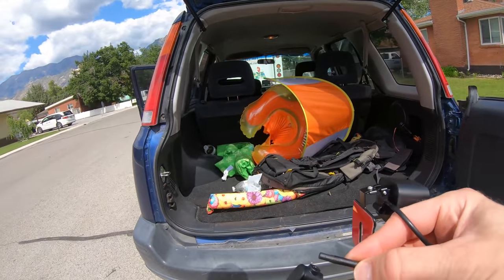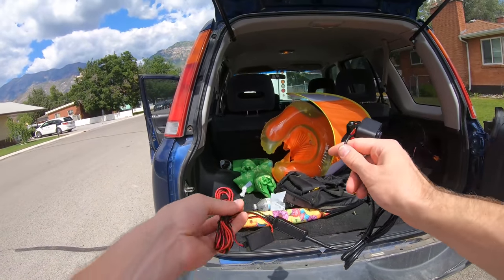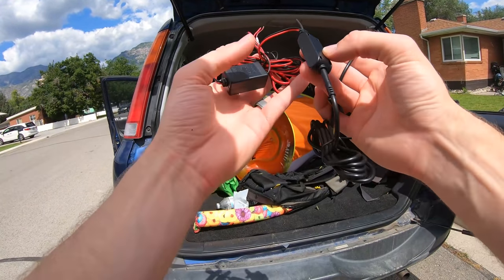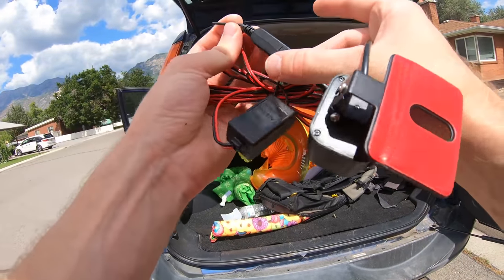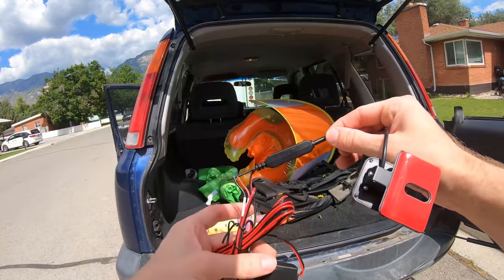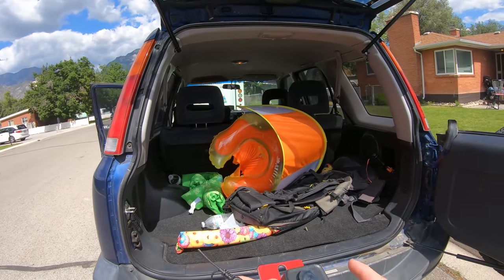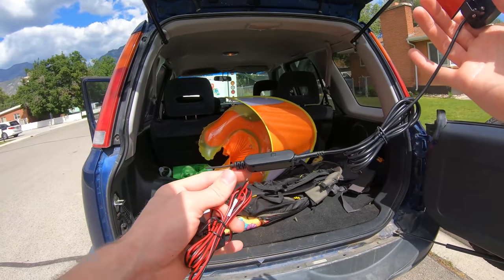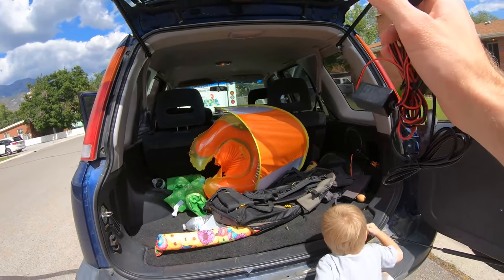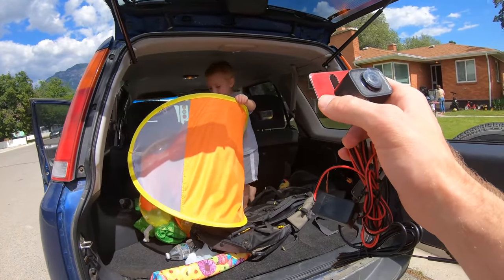Okay, I see. That was all nonsense — I figured it out. This powers the camera, so this is going to have to plug right into those reverse lights. Plenty of length — that'll be fine. Then this has a sender on it, probably in here somewhere. My theory right now is we just hook this up into the power supply back here and this is an independent system — it's got a sender in here somewhere, and that's got a receiver. The monitor up there has a receiver. I guess we have to use the USB plug-in adapter for that monitor. If I can somehow wire it into something that has power through the fuse panel when the accessories are on, I'll probably just do that so we don't take up a USB socket.